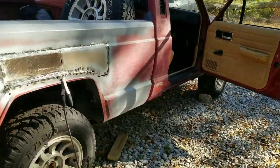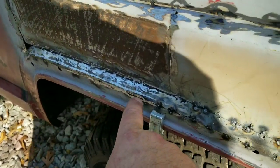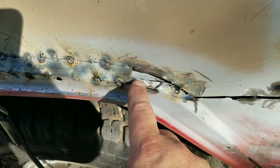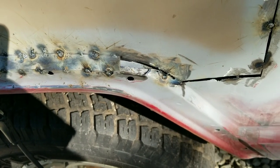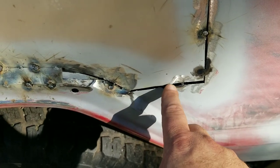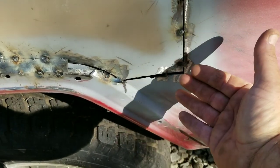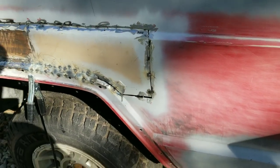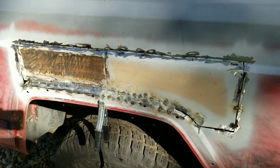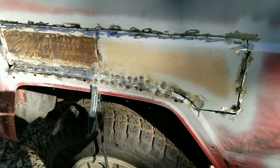So it's Tuesday afternoon. Give you a little update on what I've been doing with the Jeep. Been adding in this corner piece here with my little spot welds and going back and grinding them down. I just did this piece here. I've got this little section to do right here, and I'm going to try to fill in the best I can. This right here, I'm not going to be able to fill that, neither here. I think what I'm going to do is just take some seam sealer on the back side and kind of fill it in a little bit, and then I'll use my fiber strand or whatever to fill this. I don't even know if I have any fiber strand left. I think I've just got a light Bondo, but regardless of what I have, I'm gonna finish this up.